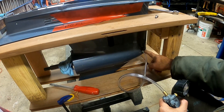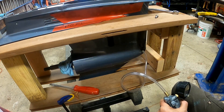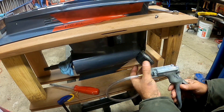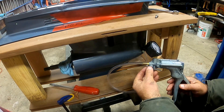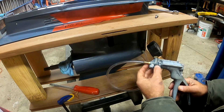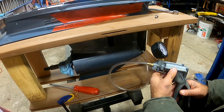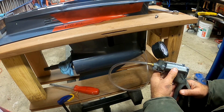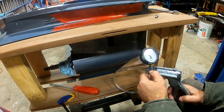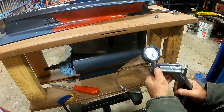The fitting I'm using comes from the lower end fill tool that I bought from Yamaha, and I attached it to this pressure vacuum pump from MightyVac. There were many brands of these pumps available online, but most of them get pretty bad reviews for being able to hold the pressure or vacuum long enough to be useful for a leak down test. Online feedback for this pump was positive for how I wanted to use it, and you can get rebuild kits in case you wear out the internals. This unit has a valve for switching from pressure to vacuum and a trigger to release the pressure or vacuum from the system.